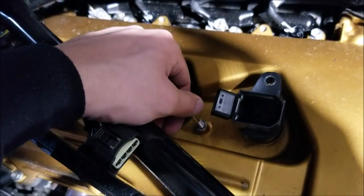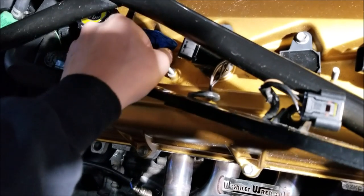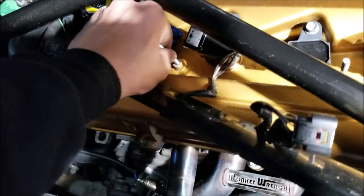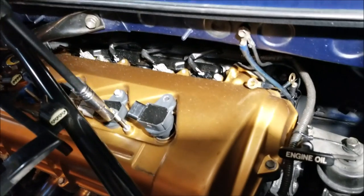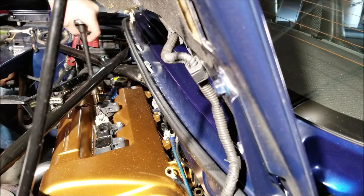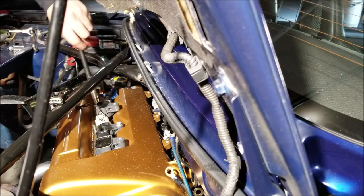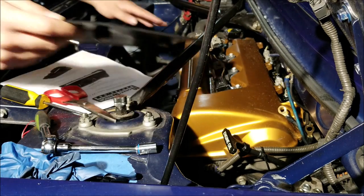So according to the directions we just screw this on until it hits the bottom — and that's the bottom. Then we put a nut on. It's always good to at least start things by hand threading so you can feel if it's cross-threaded. Like this one's not going in nicely. So I'm just going to thread this nut on — they are the locking type with that plastic or rubber in the middle. So it should be twisting to the right and driving this more into the valve cover. These are only 10 millimeters so you don't want to over-torque it.